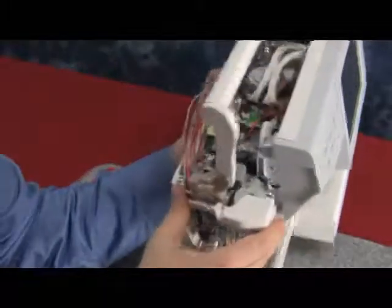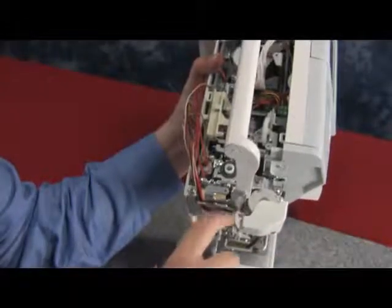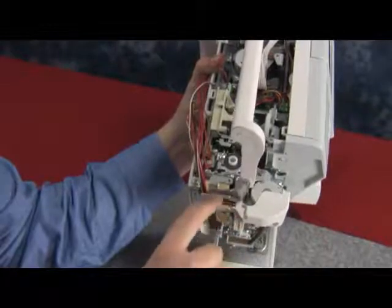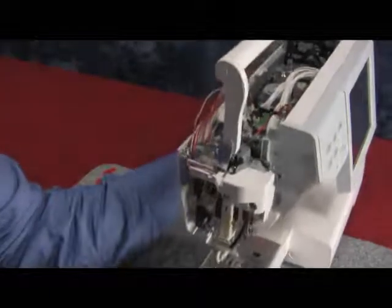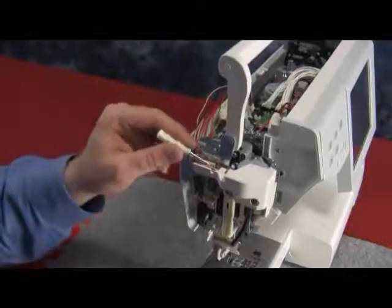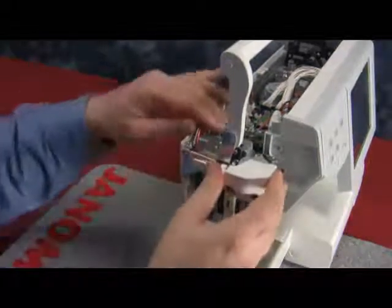and you need to inspect it to make sure no wires have been pinched between the white cover and the threader motor bracket itself. You can use a small flathead screwdriver, but very carefully, to help you guide the wires into the cover guide.